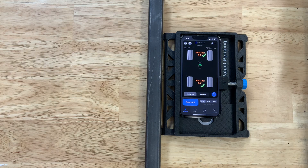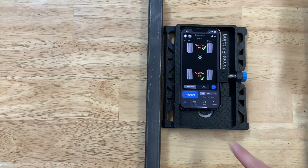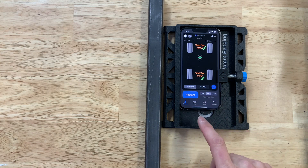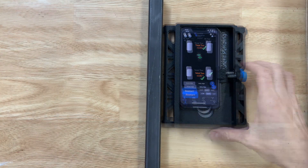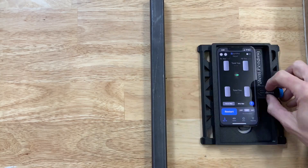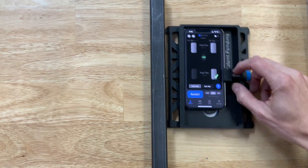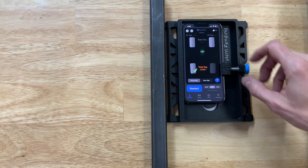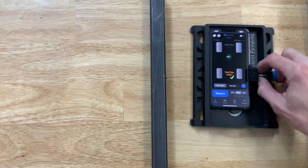This is a little bit harder because the system actually has to measure through that motion. I am in the 0.1 degree range, so I'm going to do the rest of this in 0.05 degrees. That actually rounded down. The kinds of motions I'm doing here are things like tapping the right and moving the part back and forth. Fairly abrupt — and that's about what we're getting, the 0.05s on that.